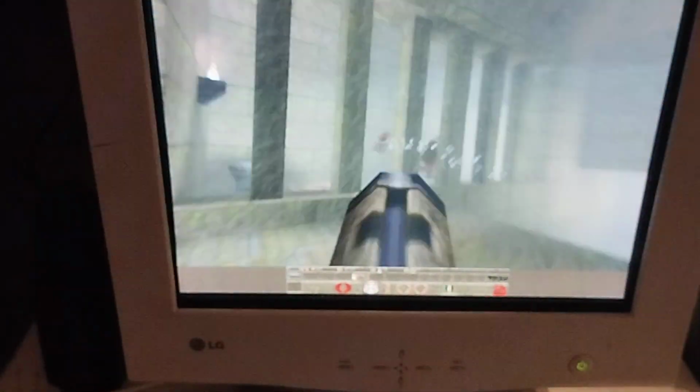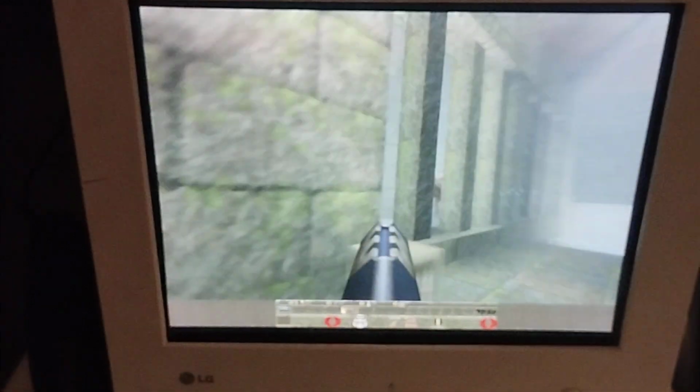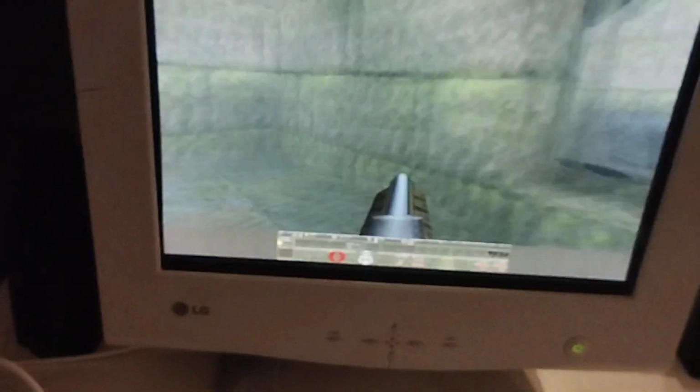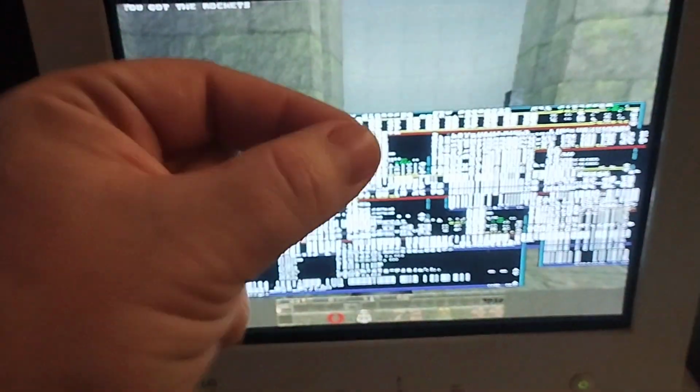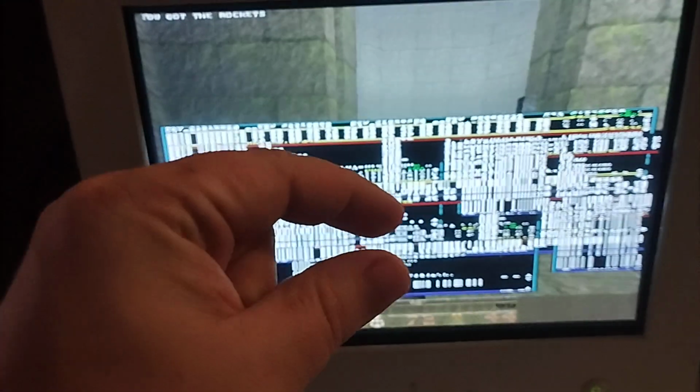So yeah, I wanted to show you this, but if I press Ctrl D here, well, this is garbled because this video mode is not supported. But as you can see, the sound is repeating all the time. Why? Because the software that manages the sound card, the driver or whatever, is continuously uploading small chunks of sound to the sound buffer using DMA.